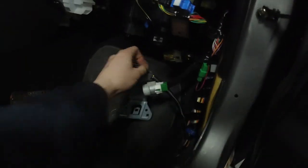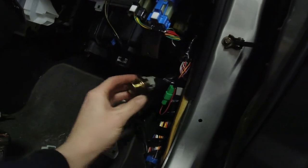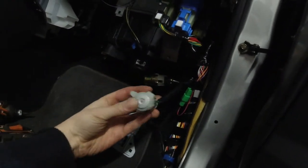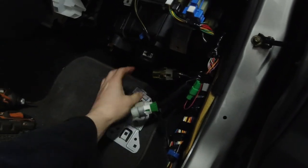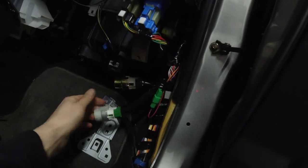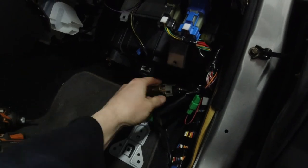So anyway, we spent three hours figuring out the throttle body code, the P2102. Finally, after searching for an electronic throttle body relay — which is this guy here, the golden boy. This is AutoZone, this is stock Denso. This is for your fuel pump, the green connector. And this black connector, the original one looks exactly the same for the throttle body as the fuel pump relay.